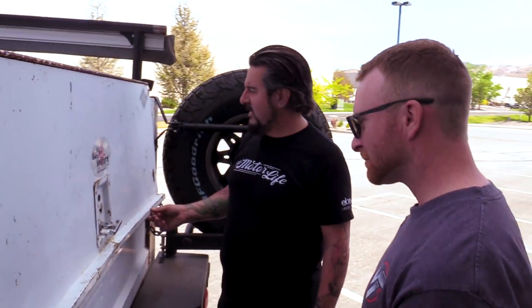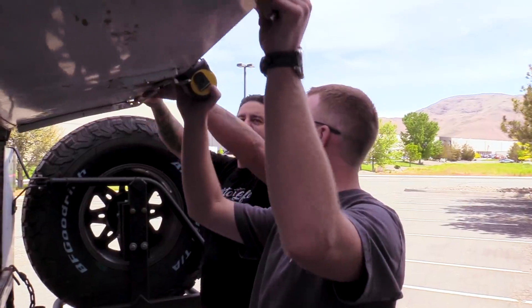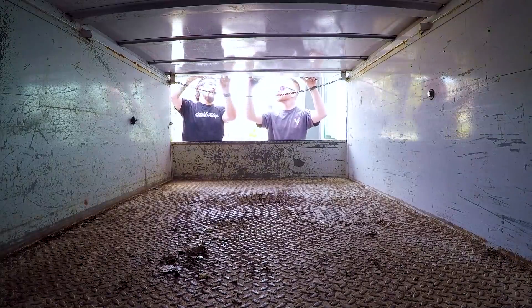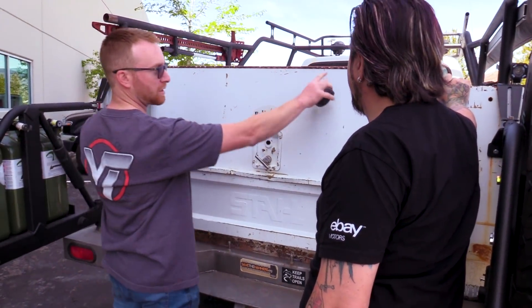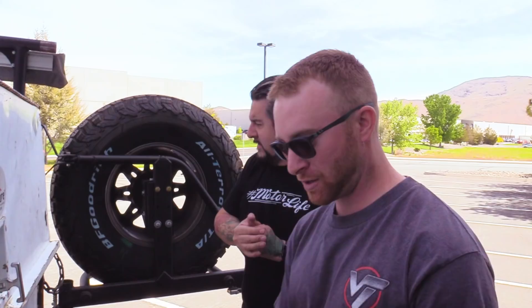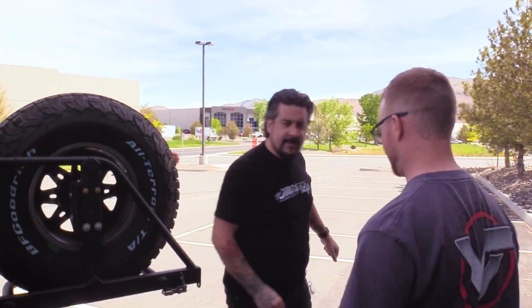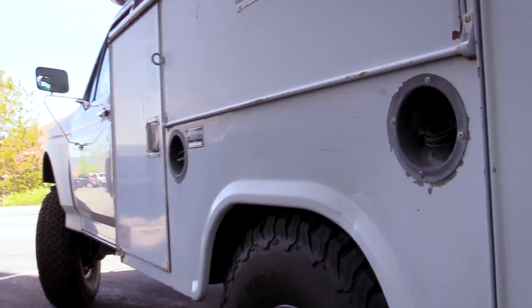But Iggy and I are ambitious dudes, and when we saw the condition of the back hatch, we had to do something about it. It's all busted up — no security left. Plus this is a point of leverage for him to push, so we can beef it up. We can probably put some gusseting in here to make it more robust, maybe eighth-inch, and tack weld it on. Not one, but two projects. The second one's a surprise. Plus we get to work on one of those awesome overland vehicles. I love my job.